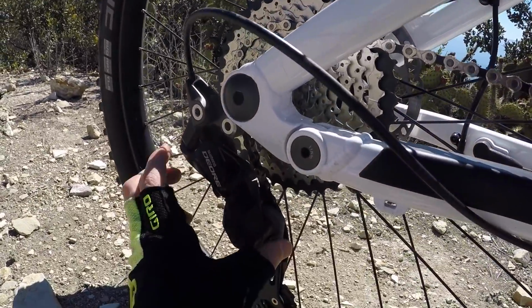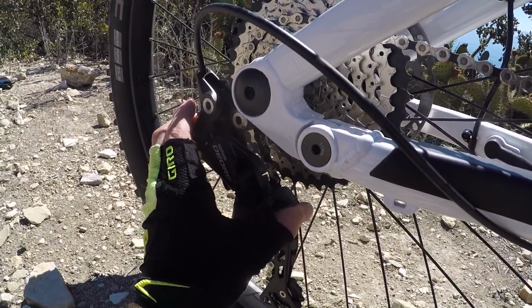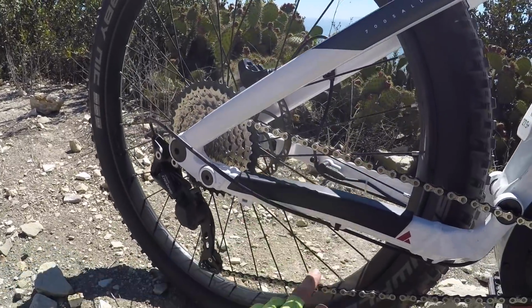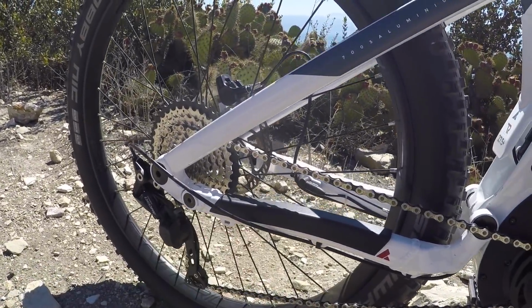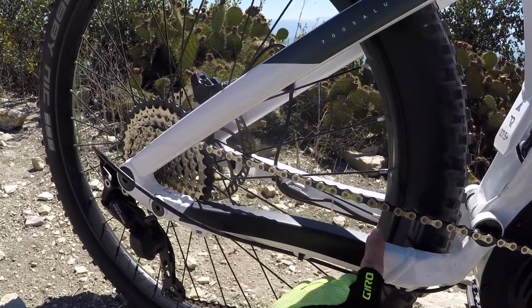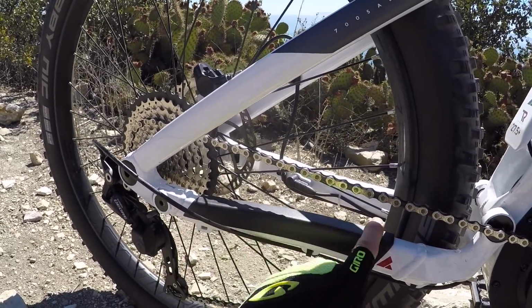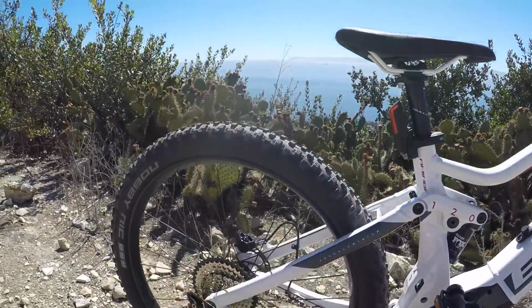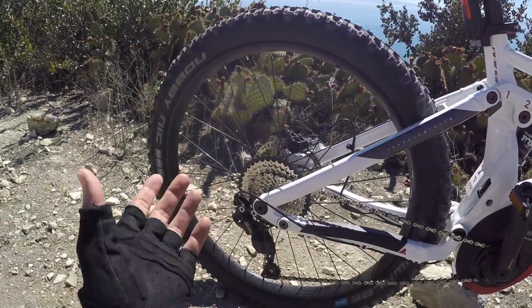And then coming back to the derailleur itself, there's this little gray lever, and if you click it into the up position, it tightens the spring, so you're getting less chain bounce and less slap. That's really nice if you're out on a bumpy section, but Bulls has gone the extra mile again with this little plastic guard from Velo, so you're not going to nick up the frame. Really appreciate that.